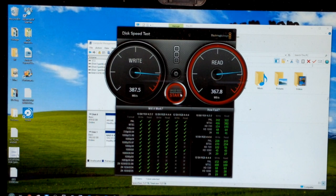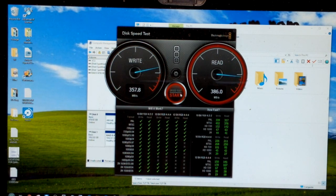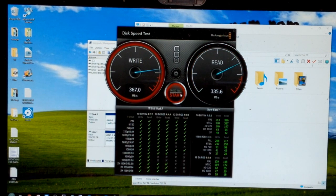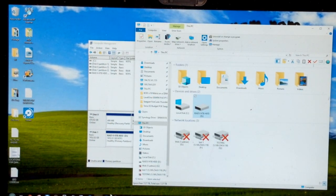So with those two drives in RAID 0 being accessed, we're getting fairly respectable speeds. Each drive would normally give around 200 MB/s individually. Right now we're seeing the RAID 0 4TB coming in at around the mid-to-late 300s — I'd say 350 MB/s averaging on write, and the read maxing out not dissimilarly. The levels do get progressively tougher during BlackMagic's random access stages, so I'd say around 340–350 average each way. That's our RAID 0 BlackMagic result.